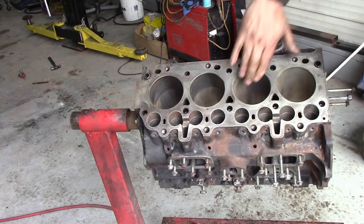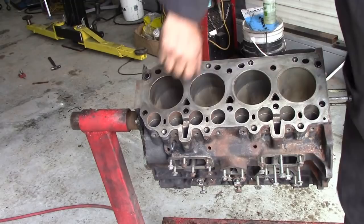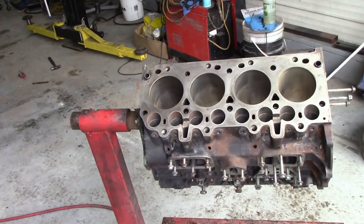I'll put an oily rag down the bore - they won't get any worse. The surface rust is really easy to clean off and it's not serious. The block face is good. I'll just put a paper towel with some oil down those bores and they'll come up like new. So next: a bit of paint.